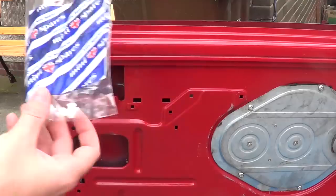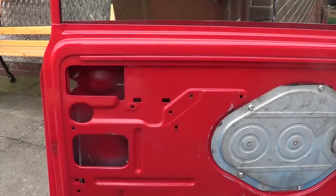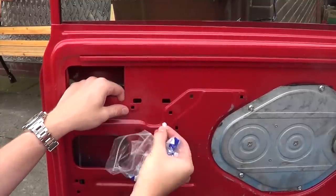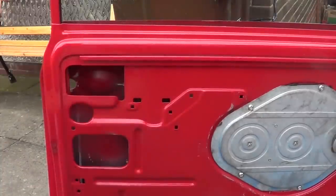Next, we're going to put the handles on the door — all the lock mechanisms. I think I've got all the screws there, so let's crack on. Also got the chrome strips for that. First thing you need is these to go in here to hold the lever arm on. Two of these should just push in, but it's going to require a bit of filing.